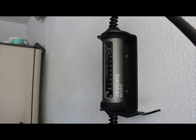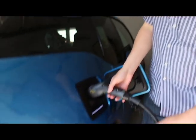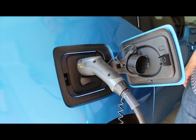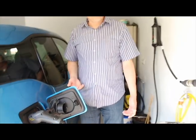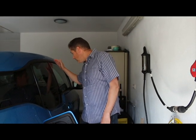The car isn't going to take 32 amps since we're talking about an i3, but it's going to give it what it can. We simply plug in, and as soon as it starts blinking blue we are now charging. Looking into my window, I'm currently at about 40% — I'm charging a little early for this video — but the charge time is about half an hour. So in half an hour I'll go from 40% to somewhere close to 100%.